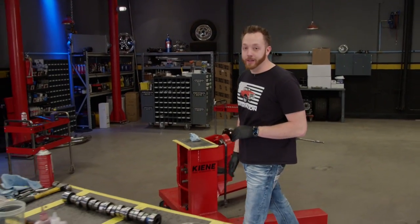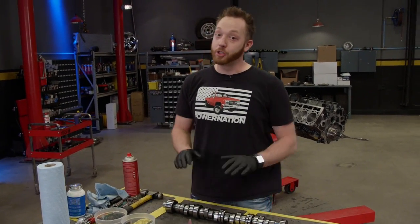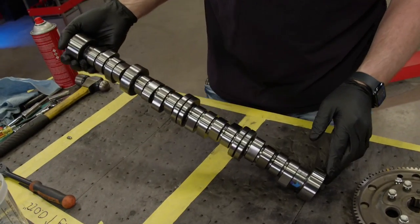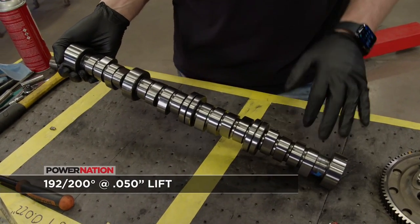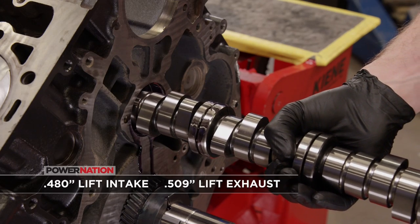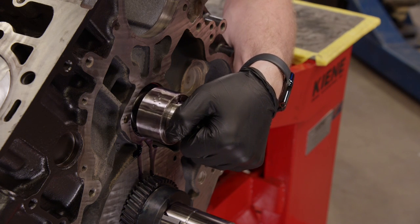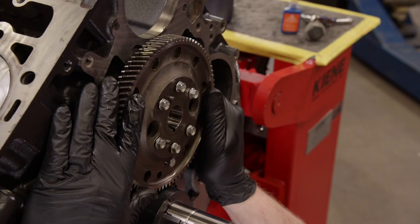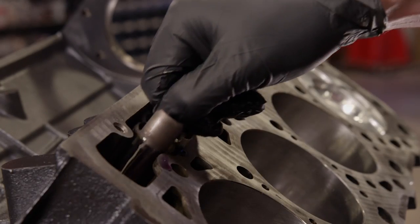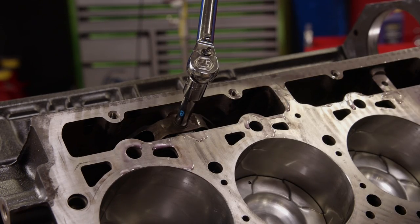As far as the camshaft upgrade is concerned, a lot of people don't think of it as a first modification when building a diesel engine, but when you're chasing really high power levels, it's just as important as upgrading the cam in a gasoline engine. We picked up this Hamilton cam from Summit Racing, and it measures in at 192 degrees of duration at fifty thousandths lift on the intake side and 200 degrees on the exhaust. This will do a couple of different things for us: number one, reduce the spool-up time of the turbochargers; number two, add horsepower; and number three, reduce exhaust gas temperature by getting more air into and out of the cylinders. Once the cam gear is in place and the bolt is torqued to spec, the lifters also get a coat of assembly lube and slide down into the bores. They're held into place by a retaining plate and a hold-down clamp, which finishes up the bottom end of our LML Duramax.